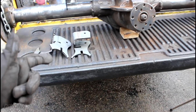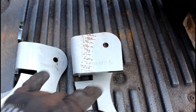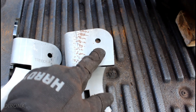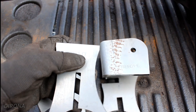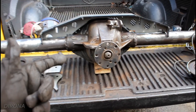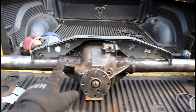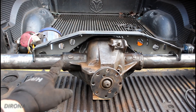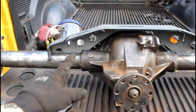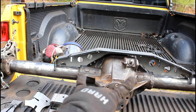The Artec kit is kind of like a jigsaw puzzle. Everything comes all cut out and nicely labeled — everything's got a letter to go with it and corresponds with a diagram on the instructions, like F, E, D — and it should be pretty straightforward. However, I am running into an issue right off the bat here. You can see that this lower part of the truss is not sitting all the way flush on the axle tubes, and that's because these tubes are welded to the housing, and this truss was not cut to accommodate that. So we're just going to have to clearance these corners a little bit on each side, keep this thing centered, and drop it down onto the axle tubes.